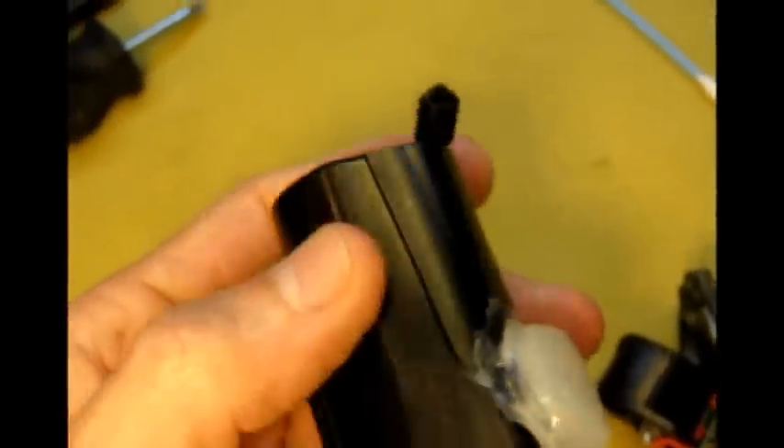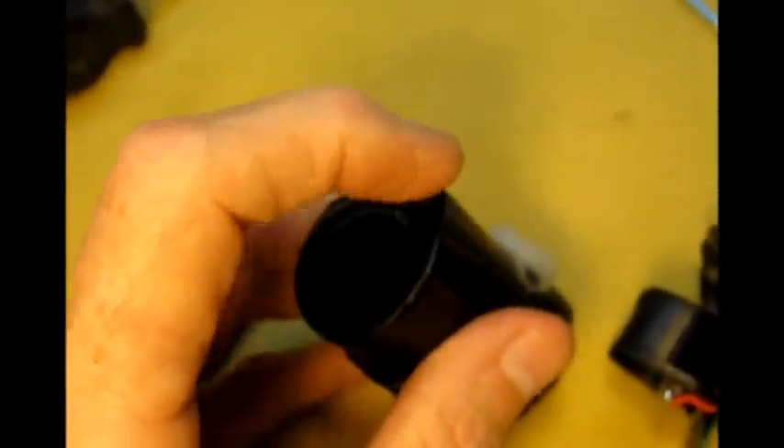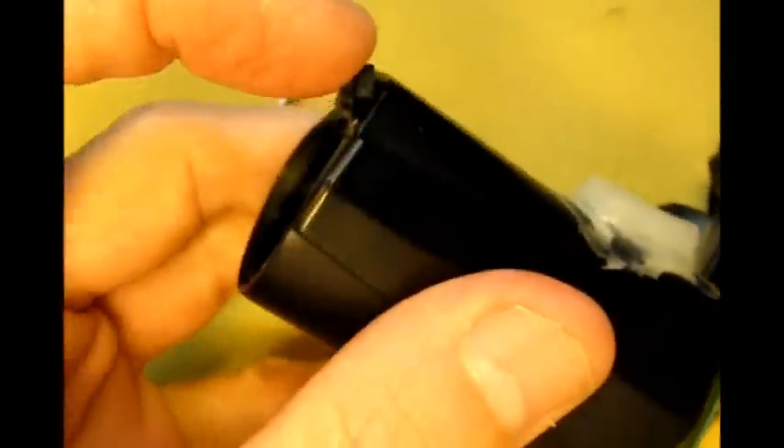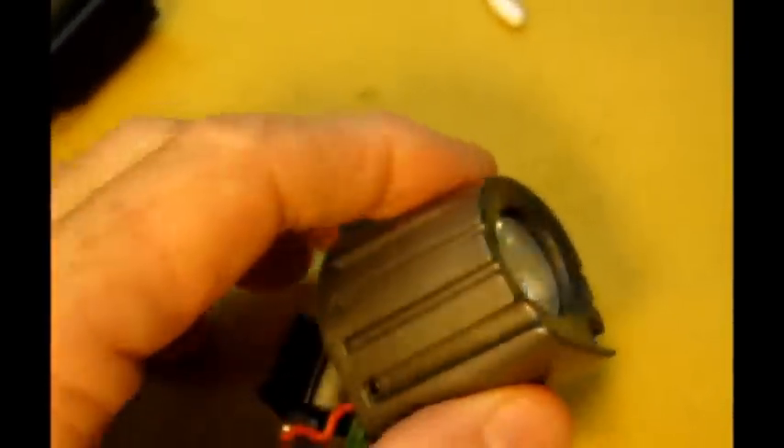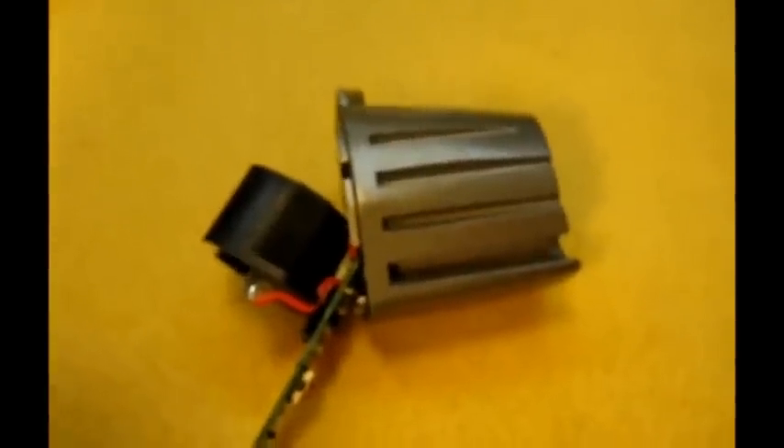You want to always be sure after charging, if you're going to ride out in the damp, make sure the little rubber plug is fully seated. It's a little bit of a trouble problem. I tend to grease it with silicone grease and then it pops in, but sometimes I forget to get it in or it pops out and I've gotten water in the unit. Just a little bit — it doesn't take much, but eventually it'll work its way up to the front and fog the lens and cut the light output considerably.